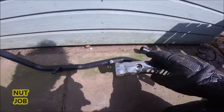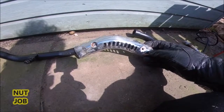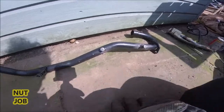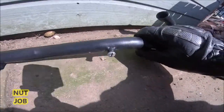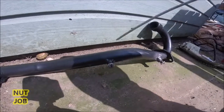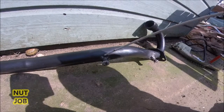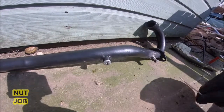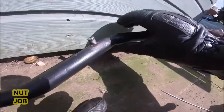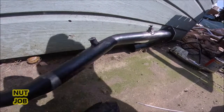is, because this exhaust pipe has a heat shield held on by two screws, as I said earlier in the video, remove one of the screws and drill a hole. Now, if we take a closer look, sorry about jerking you there, guys, you'll notice that they've put this threaded nut thing on. They just tacked it on both sides, which means if we rotate it there, as you can see, there's a bit of a gap, so it's not very good for a back pressure test.